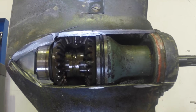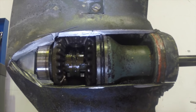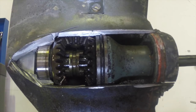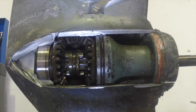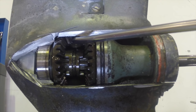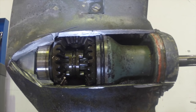So the engine can turn and the forward and reverse gears can turn constantly, while the prop shaft stays still. I can turn the prop shaft independently — they're totally independent of each other. The point is, the forward and reverse gears are always locked to this bevel pinion gear, and this dog clutch is always locked to the prop shaft. That's the neutral position.